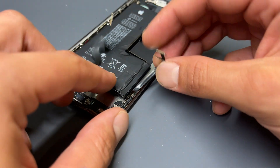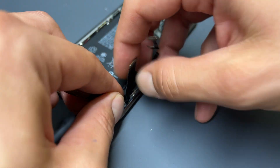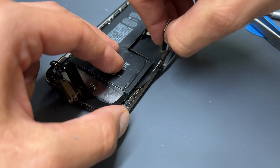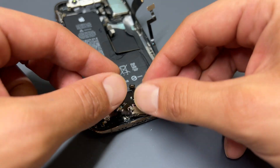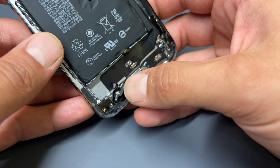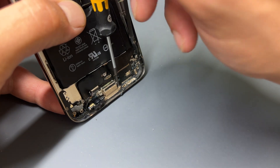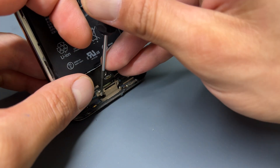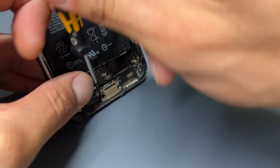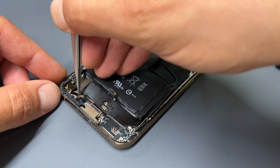To reinstall the charging port, pull this little antenna cable out of the way and then carefully slide the new port underneath the edge of the battery. It's a little bit fiddly to get this right, but it definitely beats pulling out the batteries on this one because they are difficult to remove. Once we've got that in place, we can line up the lightning connector, making sure that the holes line up properly. Install the two cross-head screws that secure the bottom of the charging port to the edge of the chassis — make sure you do this step now because there won't be another chance once we've installed more screws. Tuck this plastic part back into place and make sure that the barometer sensor goes into place just there.